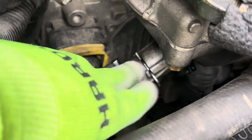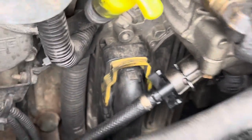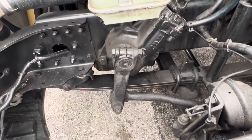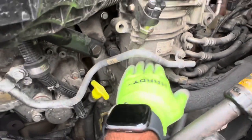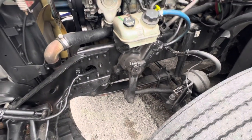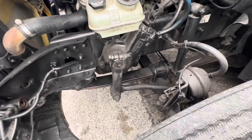So what you would do is you would turn this knob to the left a little bit, and you will start seeing the fluid leak out on the ground. So now the water that's in the bottom of your filter is getting out. You will just keep it turned left, let it keep running out. Diesel is supposed to have like a light green color to it. Just keep letting it run out. You're going to smell the scent of it.